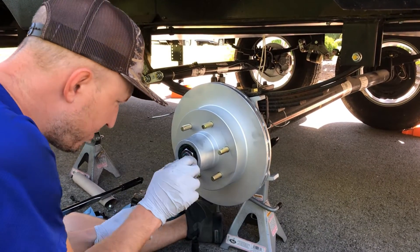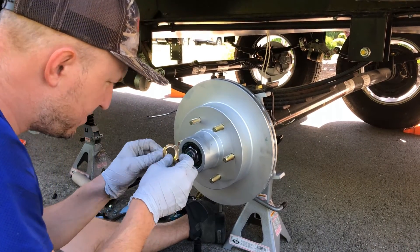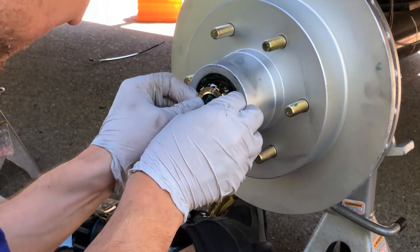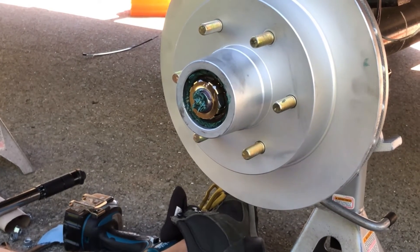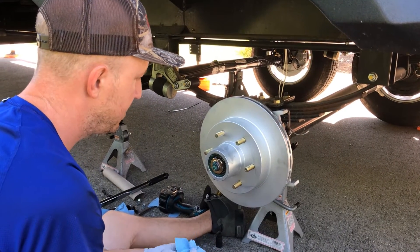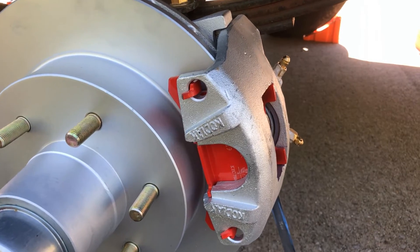Now get the retainer clip back on — clean it off. Do a sanity check that you're right up against there, feeling good. The washer has a D-shape to line up with the nut. If the nut needs to move, move it slightly looser, not tighter. That's the assembly back on there. Clean this portion where you've touched it with brake parts cleaner. The brake caliper itself slides straight in — you can't rock in the top or bottom first. Then there are two half-inch lug bolts. Torque is specified at 50 ft-lbs.